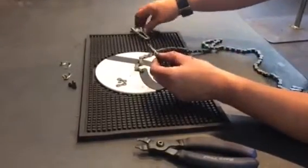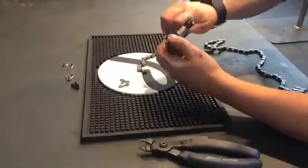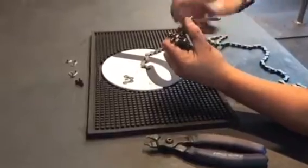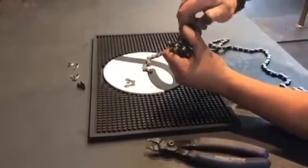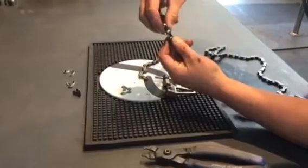What you do is you drive the pin on the chain — the rivet — three quarters of the way out. I'm going to drive it three quarters of the way out; it gets a little bit stiffer and I'm going to stop there, so the pin is just sticking out like this.